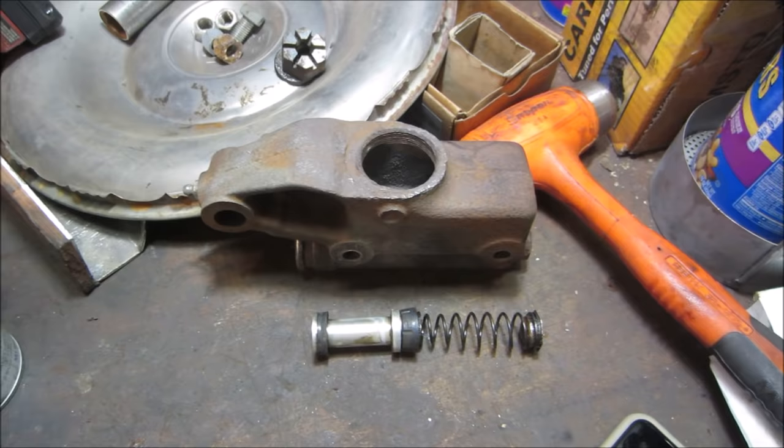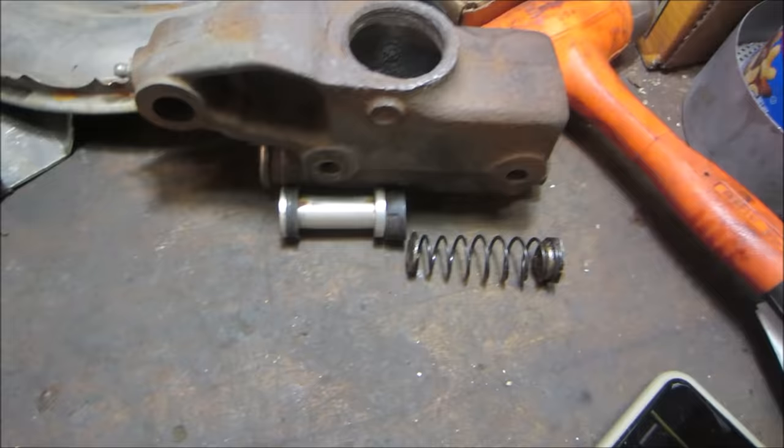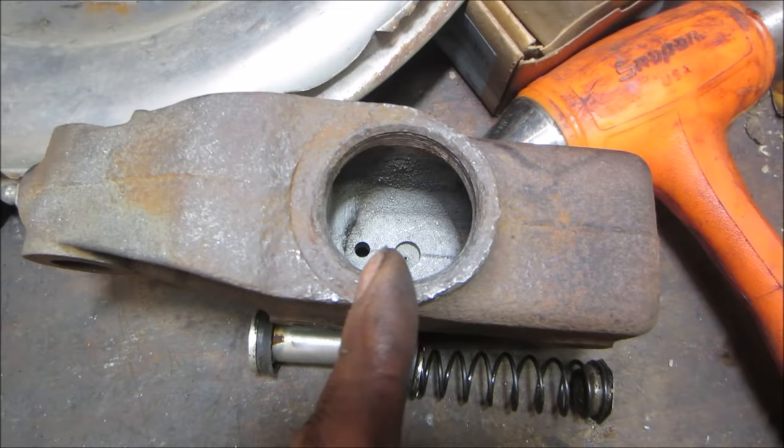All right, so you've got the bore down below. This is where the brake pedal rod is pushing on, so it pushes this whole assembly forward. Just probably better off leaving it where it is. That whole assembly pushes forward. There is this cap behind that first hole, back about this far. It allows brake fluid to fill up this cavity right here.